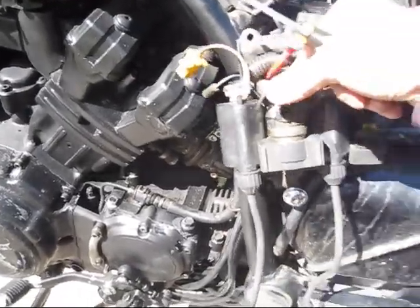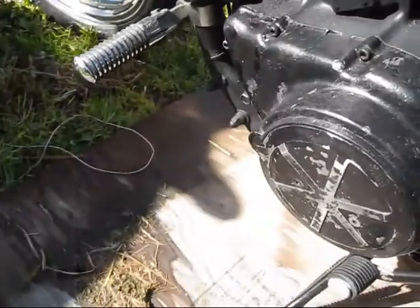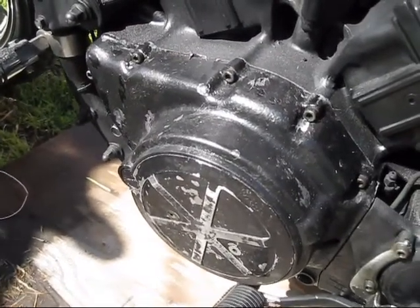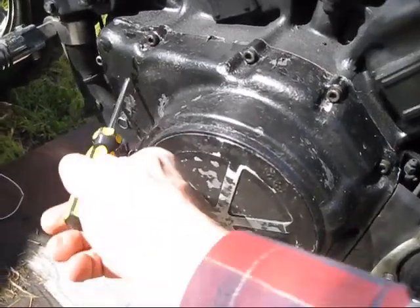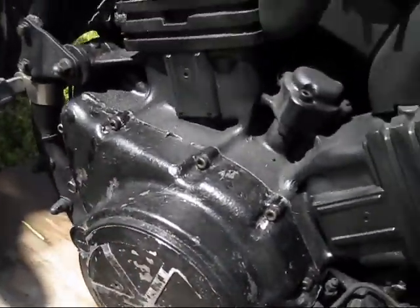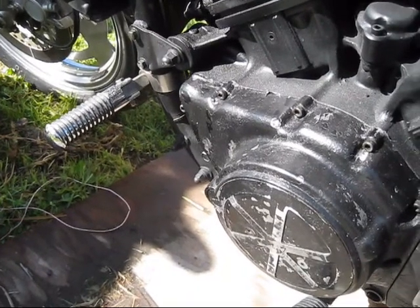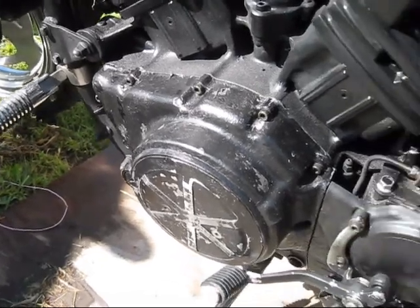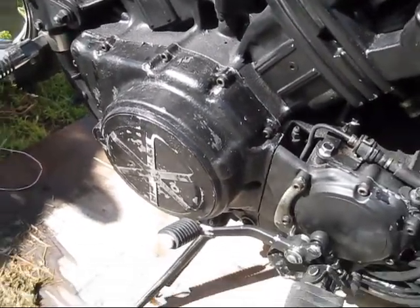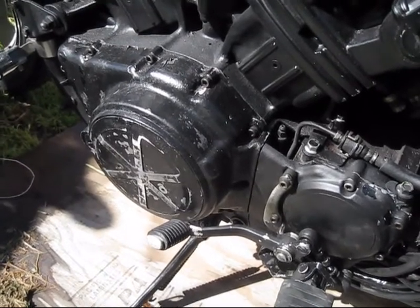I made sure I've got a good battery. What I'm going to do here is jump this. I can hear it just turning. There's a one-way clutch inside of there. I have a feeling that it's the clutch that is bad and not the starter itself.